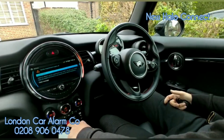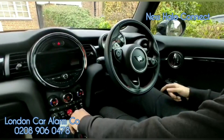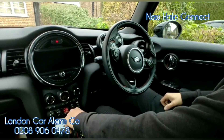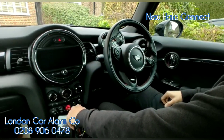When you get the vehicle back, it's really simple: main ignition on, insert the code, two bleeps — it's now out of valet mode. If you then try to start it and select a gear, the vehicle will immobilize. We won't demonstrate that again so we don't use too many credits on the system.